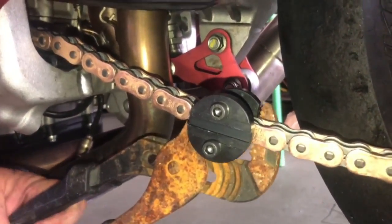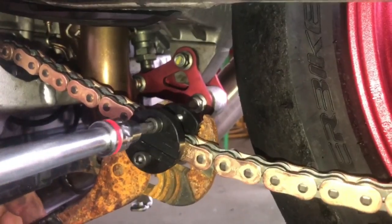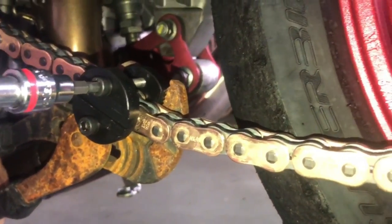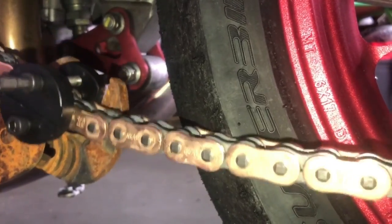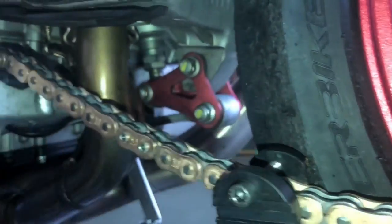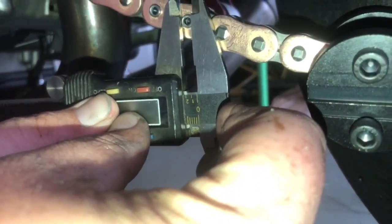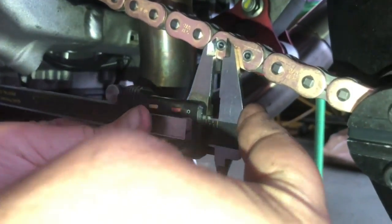So, put our channel locks back on there, and we will do the A-B method again with the bolts. We are at 6 on the dot. So that one is flared perfectly. We just need to give a touch on this other one here.